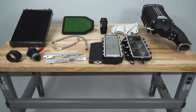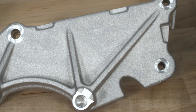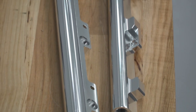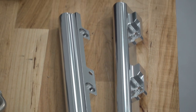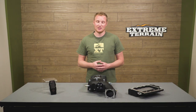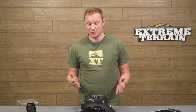This is going to be a more involved installation because you are pulling the intake manifold. With the centrifugal style, you're not having to do that, so there are definitely pros and cons there. From a price standpoint, they're going to be pretty similar — this is pretty similarly priced to a lot of other supercharger systems of any different design. Any time you go with forced induction, you're going to be spending a good bit of money, but if that's what you're looking for, I think this is going to be a really nice kit.